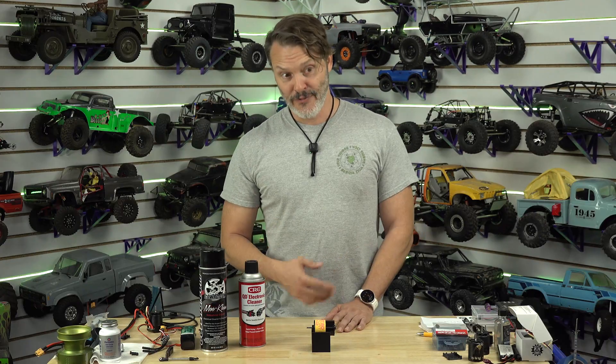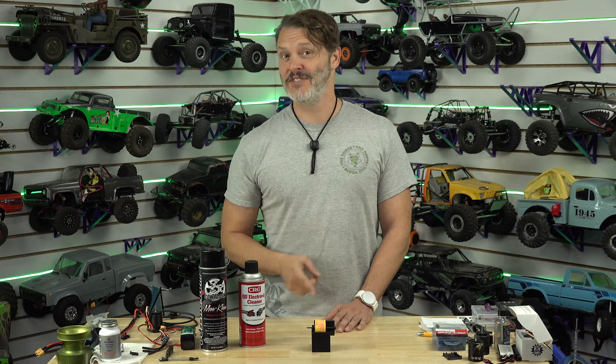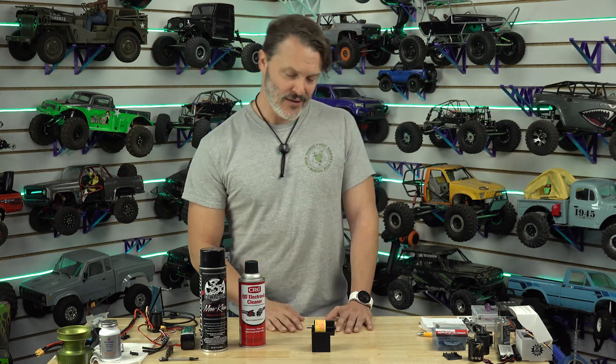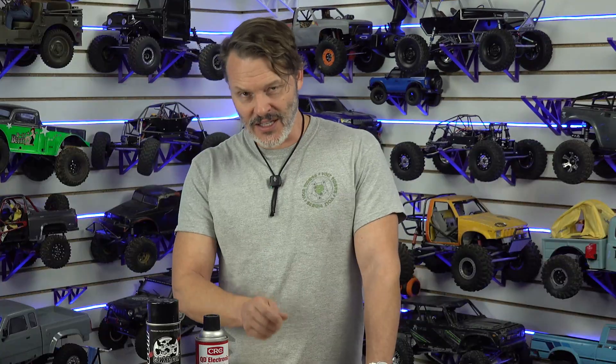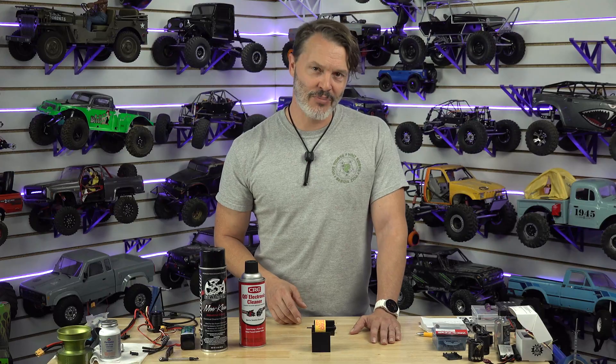So that's basically it. If you want to race with these motors, you want to break in your brushes fully for maximum performance. If you don't care about performance, then don't even worry about it — but you're going to be replacing your motor a lot quicker when you break in the brushes. So we're going to break them in for expediency — we would do it in water. Every motor is going to be different, every brush is going to be different, but for my motors it's going to be something like half an hour at three volts, and then a little bit of faster speed. We want to make sure we bed those brushes in at the higher speed too. If you really want to be extra about it, you can break it in in reverse to try to get a little extra RPM in the forward direction. But that's more of an argument for the comments, because everybody's got their own ideas on racing.